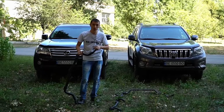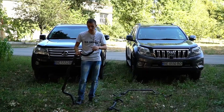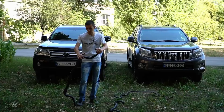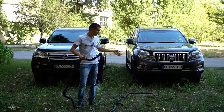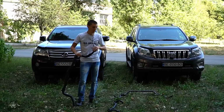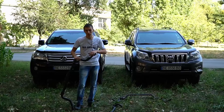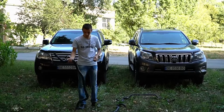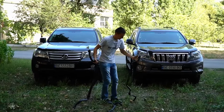But if a smile doesn't leave your face after every bump, every speed bump or railway crossing, then this video is exactly for you today. I will explain step by step how to dismantle this system, install a regular stabilizer and get a smooth, comfortable car like the good old 120th Prado. Of course, naturally the car will become more wobbly and won't have the same good stability as with KDSS. The reasons why and what will change I think don't need to be explained to you.